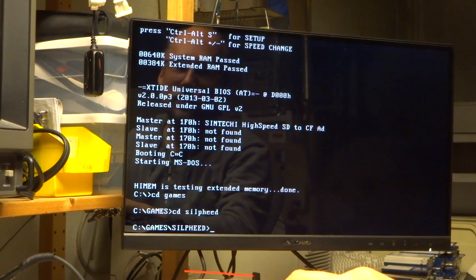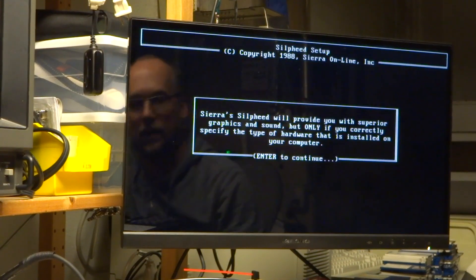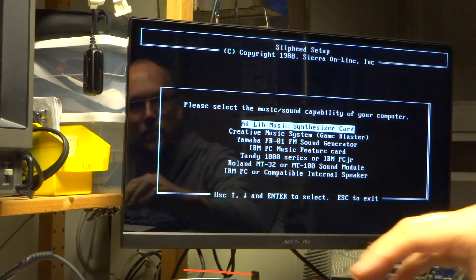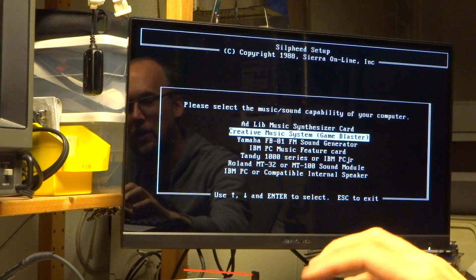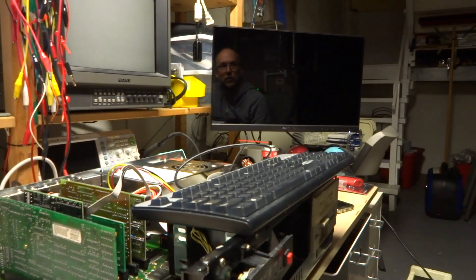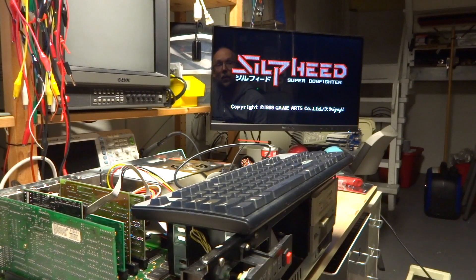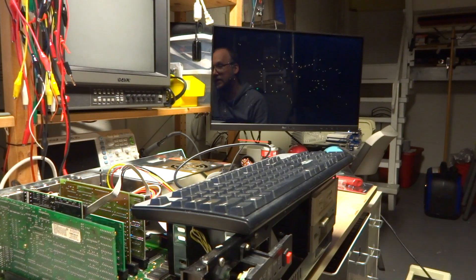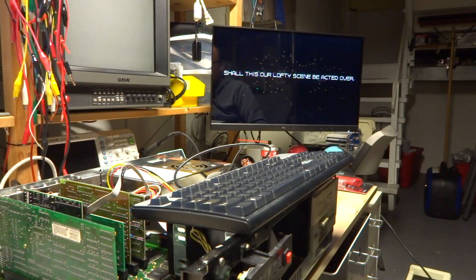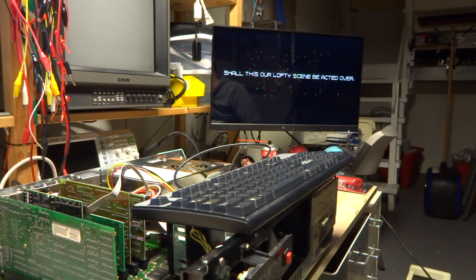To change it over to use the CMS, we have to run the install, which will allow us to configure the sound card. We're going to pick EGA graphics since that's the best with this game. We have AdLib music synthesizer, but we're picking the Creative Music System, also known as the Game Blaster. Let's run the game. How does it sound? Here comes the music if it works — or it's busted, I don't know. The chips might not work, the card might be broken. So I don't think both channels are working — probably one of the chips is not seated correctly. I'm going to re-seat the chips and see how that goes.